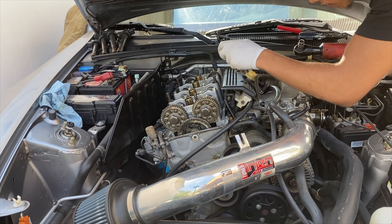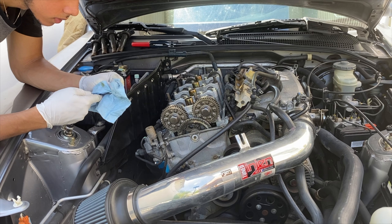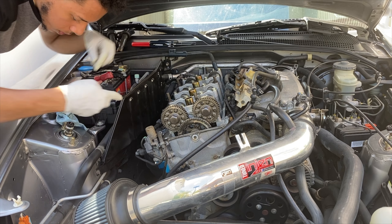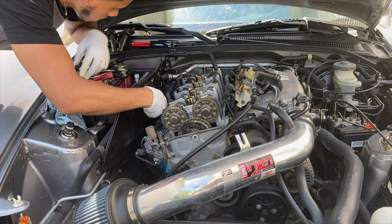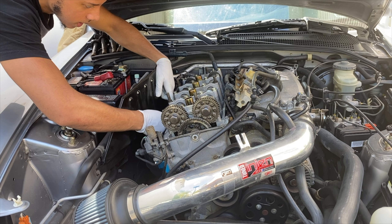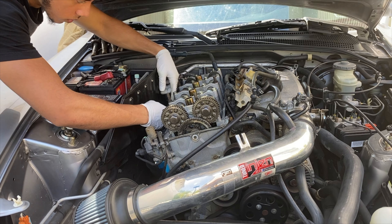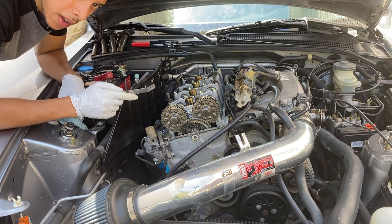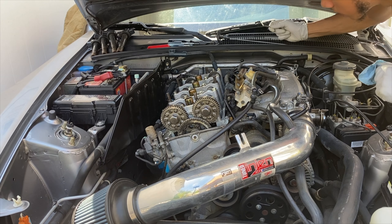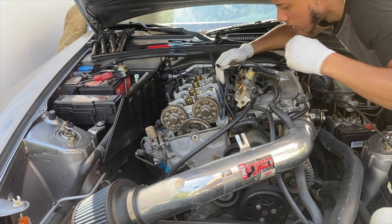It's a little hard to get to the ones on cylinder three, so I'm gonna take this little shield off. Same thing as cylinder one — check over here, make sure it's in spec. Try to get the gauge as straight as you can. I know it's a little awkward over here, but try your best. Once you get it in between the valve and screw, try to flex it and bring the tool down to get it as straight as possible for a more accurate reading.